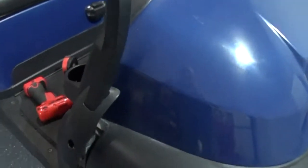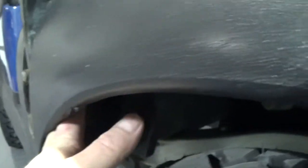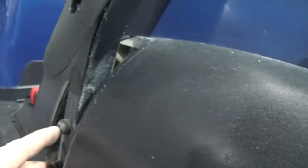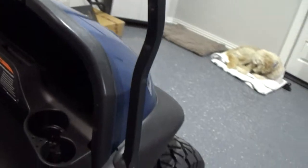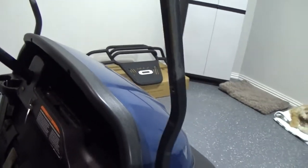Plan B on this — I realize these Torx head bolts are really tight because of all the water and slop in this fender well. I got them loose but I'm afraid they might snap off if I keep working them. It doesn't look like we need to take them all the way out, so I'm going to cheat a little bit, leave the upper struts in place and just leave them loose. We'll pull these four bolts out of our cowl piece and remove our plastic body.